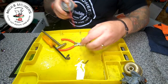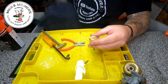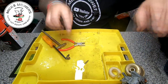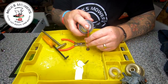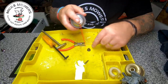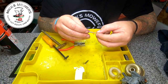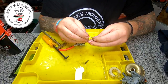We know that carburetor is now running clear. The actual float itself has got loads of crud on there which just wants taking off, so spend a bit of time cleaning that float. The needle will be fine — just a quick wipe off. And then it comes down to the main jet itself, which is the reason why this carb wasn't actually running. If we turn this on its side, you should see liquid come out of both sides — but this side is restricted. So I've got a little tiny thumb drill — you get packs of them on eBay and Amazon.